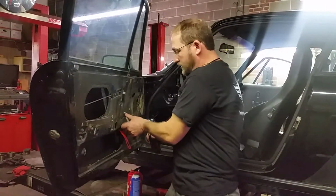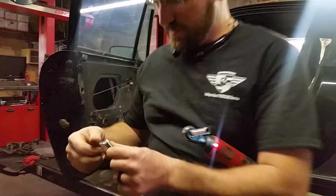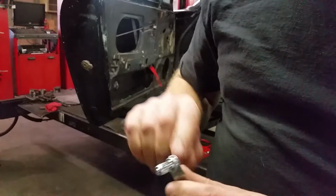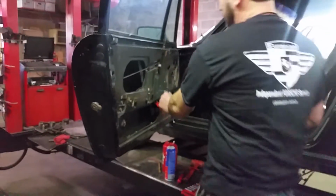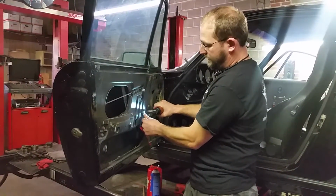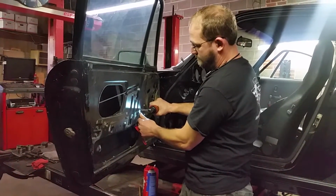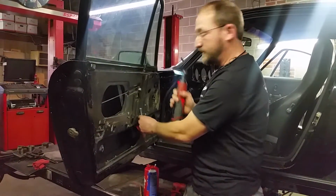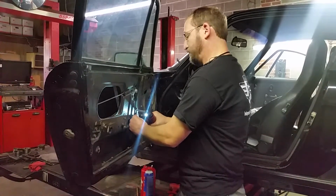Okay, so now I skipped a little bit, already installed one jack nut. So you can see how this thing assembles right here. You have your install bolt here, this threads into that, and as this tightens up, this shortens this and expands those. Okay, so sort it in the hole, got my quick little wrench. That's it. Now that is installed and expanded.